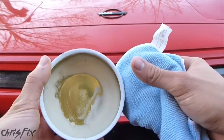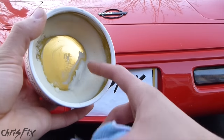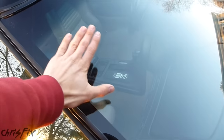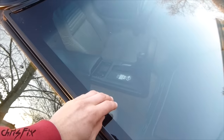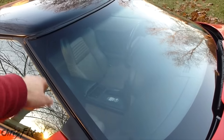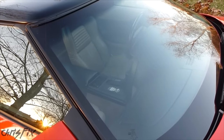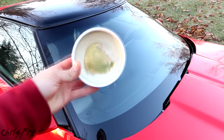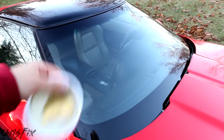This last step is really what gives your windshield that extra something, and it's using regular car wax. Any carnauba or synthetic paste wax you use on your car's paint, you're going to use on the windshield. Waxing the windshield puts a protective layer that beads up water better than Rain-X, prevents bird poop and bug splatters from sticking, and also prevents ice buildup — so on cold mornings you don't need to scrape the ice off. I find that wax lasts the longest — four to six months where water beads up and bugs come off with just one wipe of a towel.